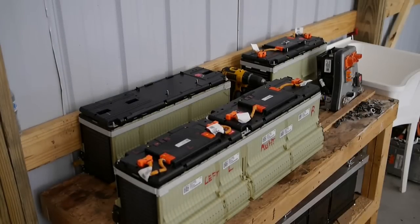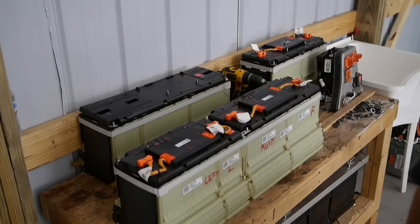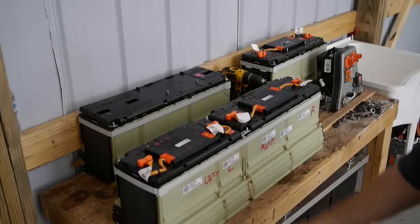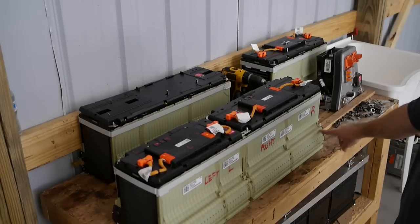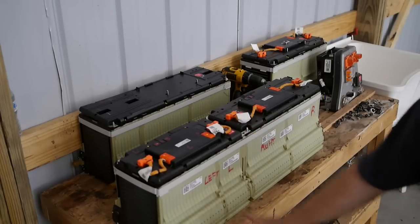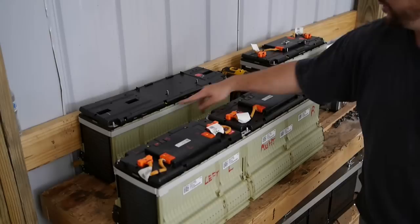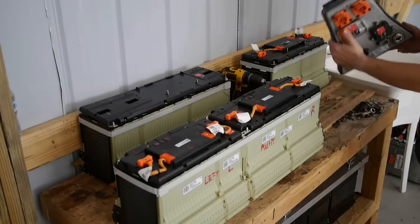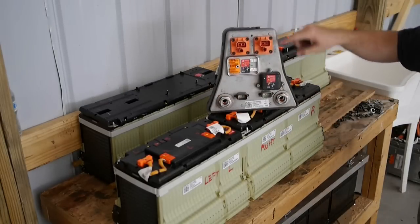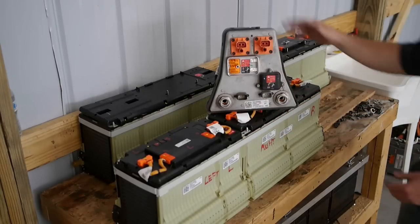Here we have the entire pack broken down into modules. The entire pack is made up of a forward module, a middle module, and a rear module. Each one of these modules is made up of combinations of 48-volt and 24-volt modules connected together in different configurations. In the rear you've got what looks like two modules together, but they're actually all bolted and banded together. There's a 48-volt module, a 24, another 48, and another 48. The front pack is made up of two 48s and a 24, and the middle pack is just 24. Up here is the front housing for the pack, which shows where the charge port comes in. This is the main connection going to the inverter, the BMS connections, and the coolant connections are here.